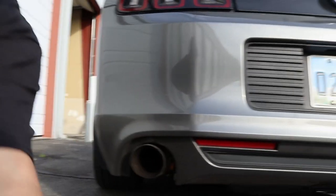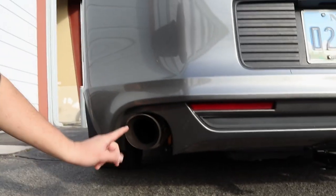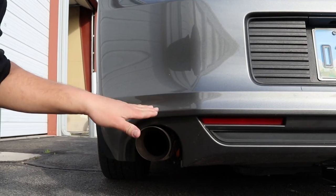Going around the track, you go around corners and your body twists and everything on the car twists. It turns out my exhaust twisted a little bit, and if we take a look right here, you can see this tip right here is actually up against the bottom of the bumper now. So I just need to readjust that — nothing too big of a deal — but I don't want it to melt anything. It doesn't look like it's melting right now, but it does have a little rub mark on it, so I do need to deal with that.